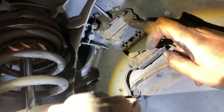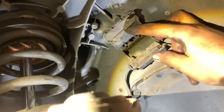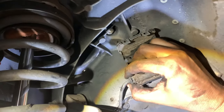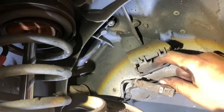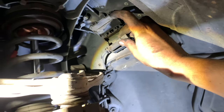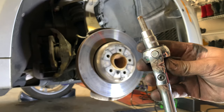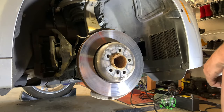There was so much dirt in that box. I didn't realize the brake wear sensor is only on the left hand side, so I was going to show how to replace it — it would sit right above in that free space. It's a really simple installation: you just follow the line, remove the old sensor and add the new one back in. You can pop it out from where the sensor sits in the caliper and push it back in.